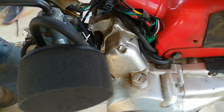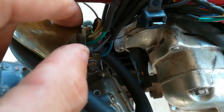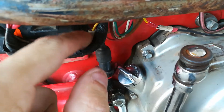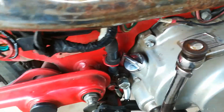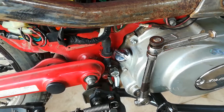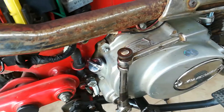The problem I had was this engine was producing too much voltage and kept blowing the parker and headlight. What I've had to do is from the plug, I've run it to the black wire off the key so it's running off regulated power now. The unregulated wire travels all the way around into the voltage regulator, but I've left it a female on this end so if you were to put a postie engine in you can basically plug that in and have your original wiring. The headlight system is running through it at the moment because there's a brown wire soldered onto the yellow wire for unregulated power, which will blow headlights off this engine's magneto anyway.